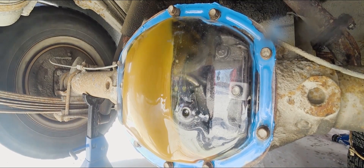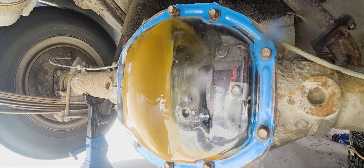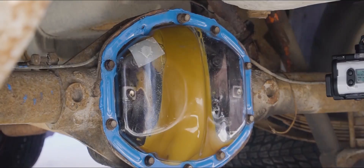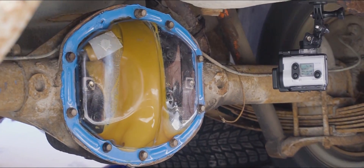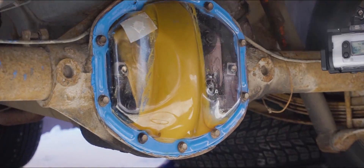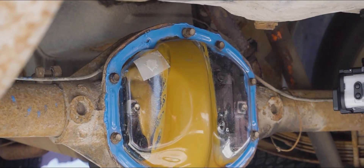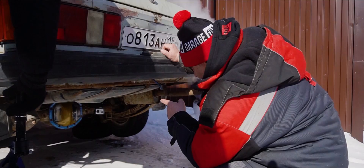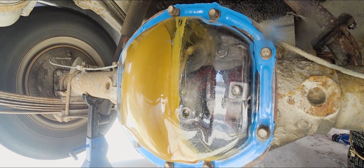Let's see what happens in fourth gear. Now it's getting splashed around — chunks of it are flying around. It's slow to drip back down. Yeah, it's frozen — you can see chunks of it falling down. So that's how transmission oil behaves in the rear diff. The left bearing is receiving some oil, while the one on the right is dry. How did that happen?